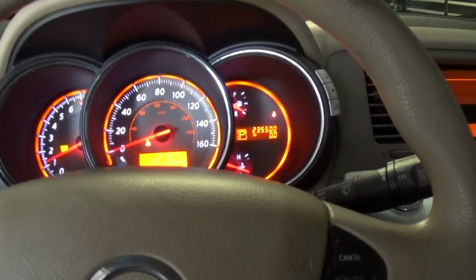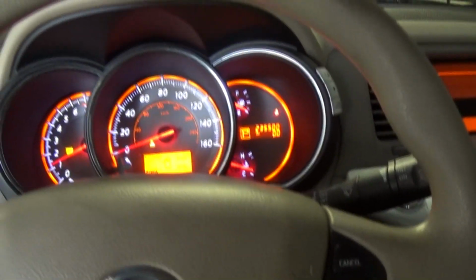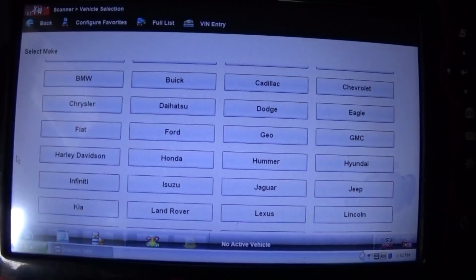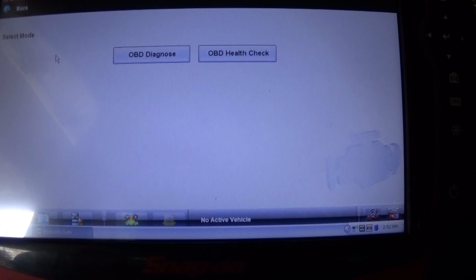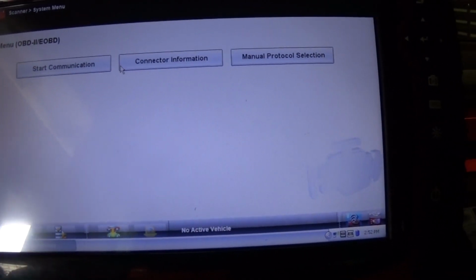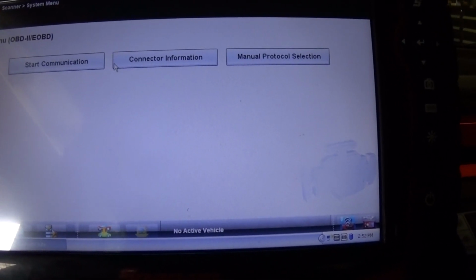And okay, next thing is just take it for a test drive and see. Gonna get the scan tool. We're gonna look at the fuel trim and go from there. I mean, so far so good. Idle is fine. There's an exhaust leak. There's a big old hole in the muffler there, but idle wise it's pretty steady.